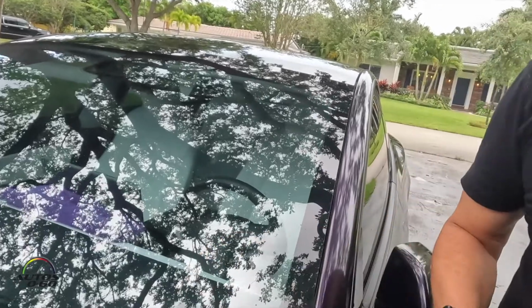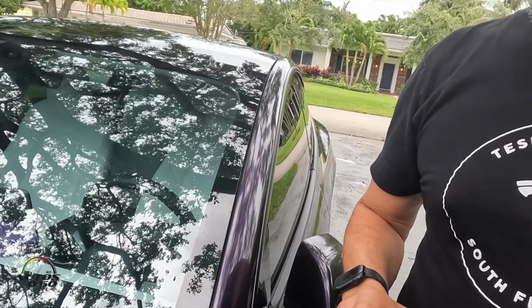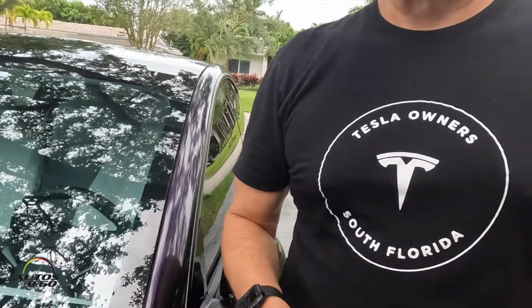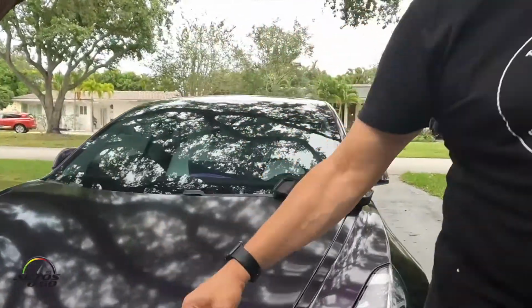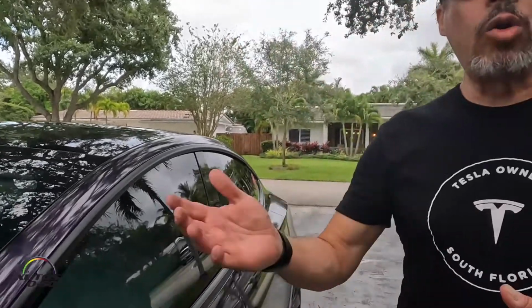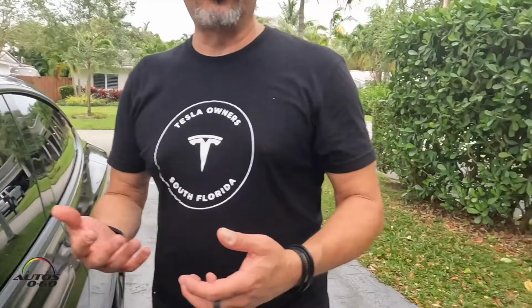So in that kind of emergency, you just put them up, and then you let the tow truck guy pull the car up and move it. In the case that the car needs to be lifted by one of the corners, at least you have this and you can give it to them so that they don't damage the bottom of your car. But usually if there's an emergency where they have to tow your car, you put it in tow mode, which basically puts the car in neutral. There's an opening in the front here. You remove this, and inside the front trunk there's a tow hook so they can pull it on a flatbed. With these cars, you should never use a regular tow truck. You should always use a flatbed. Because they cannot lift it by the wheels.